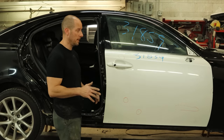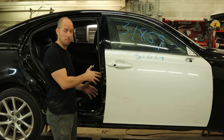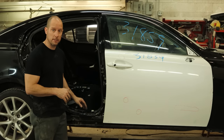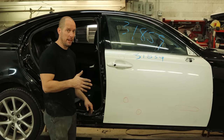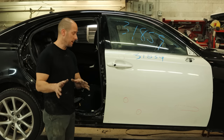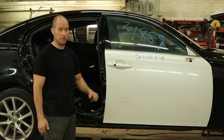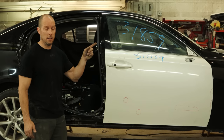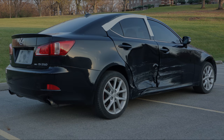That's as far as we're going to go on our Lexus for today. We got everything apart, we got our used door up there and it fits pretty decent. I'm hoping the rear door will just bolt on and fit pretty decent too — then we could just change the outer piece and not worry about pulling too much. We're still going to have to pull the dog leg out a little — that's why it's up on the frame rack. We don't have it clamped up yet, but I might have to to pull that out. We'll do all that next time because I've got to go pick up the door from Scott's Lexus Emporium. This one came from another yard — Scott's was fresh out of front doors. So I'm going to go do that, and I will see you guys in the next video. Thanks for watching — see you guys next time.